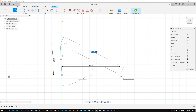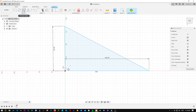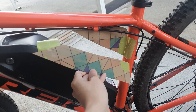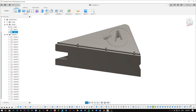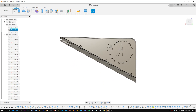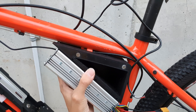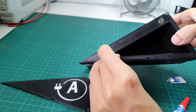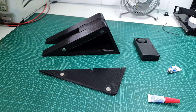In Fusion 360 I began the design of the speed controller mount. The triangle on the Trek frame was smaller than the average bike and with my poor choice of purchasing the biggest battery available, the measurements had to be precise. Using some cardboard to measure out the available space, I created this controller mount. My original plan was a closed case, but I decided on an exposed mount to allow passive air cooling and provide more space between the battery and the ESC. I also included a small compartment to store my alarm system, a wallet, or keys — with a magnet recess allowing a door to magnetically seal the space. I added my logo on the side and painted in the indents.